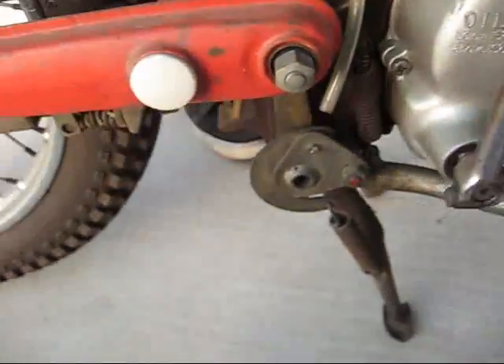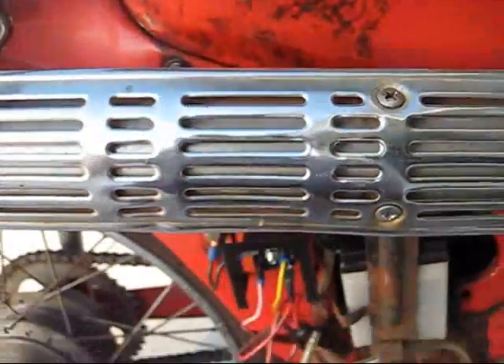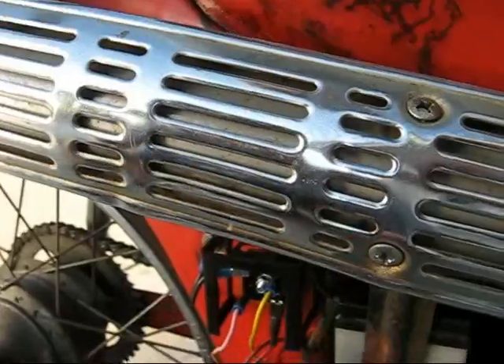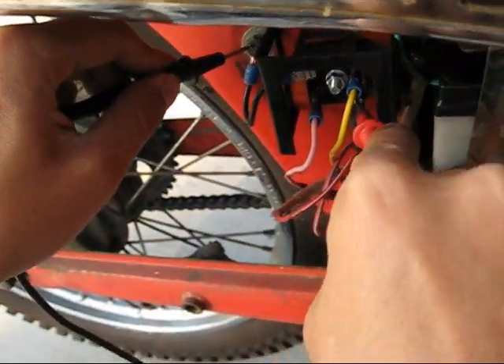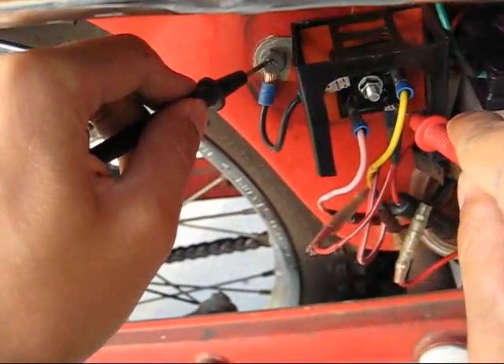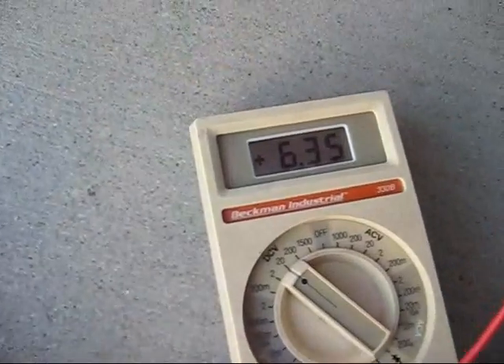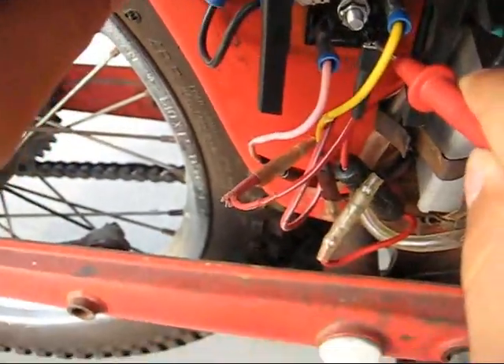Kick it hard. Alright, here we go. Can you hold this so I can make the measurement? Sure. Gotta use two hands to measure it. Positive — and then look at the multimeter. 6.34, 6.35 volts. Yep, charging up pretty good now.